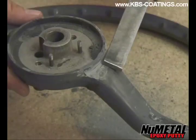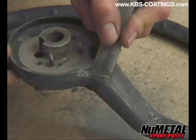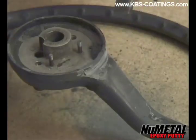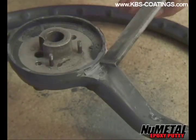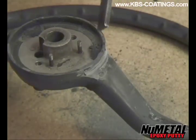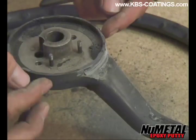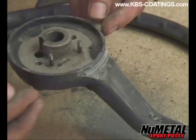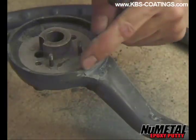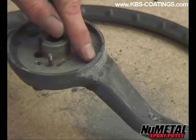There's an original part of the steering wheel there, and just over here there's a little bit showing through again, so I can already see that this is where the crack was and the material's in there. I don't have too much material. The reason why I'm being so precise in this area is that when this goes back on the car, it's going to be sitting over a sleeve. The sleeve on this one will be sitting on the inside and it'll be level with the outside of the wheel also. That's why I'm trying to get a nice precise finish through here, around the centre of the wheel, and on the inside.